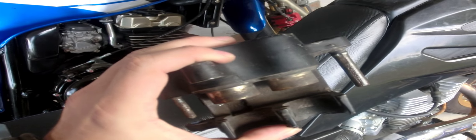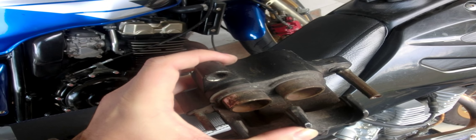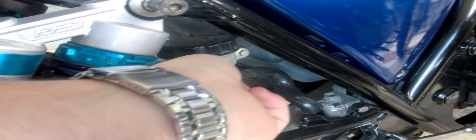However, a lot can go wrong with disc brakes — especially older ones — because seals inside can break, and air bubbles can get into the system. You don't want air bubbles or any dirt inside your brake system. What I'm going to show you in the future is how to bleed brakes — that's how you remove air bubbles. Here's the rear master cylinder on the CB — a reservoir where your brake fluid stays. When you push the brake pedal, a small pump pushes the fluid all the way to the caliper.